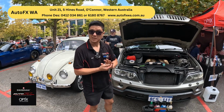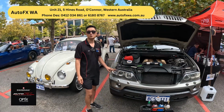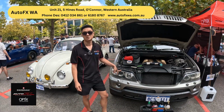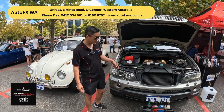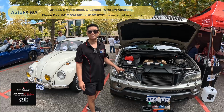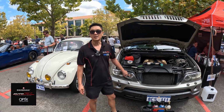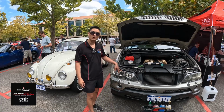You get a lot of people who say put some ceramic coating on it, but the ceramic coating still breathes, so it's still not going to give you years of protection. Ceramic coating is only going to slow the oxidation down a little bit by a few months. Whereas if you put clear coat like the paint on this car, or put the urethane film over the top of it, then you're going to get years. We're talking that 5+ years. The film is also stone chip resistant.